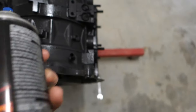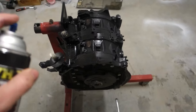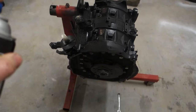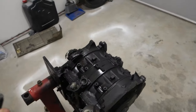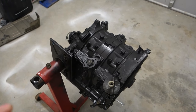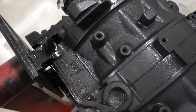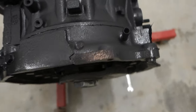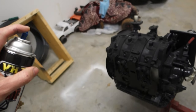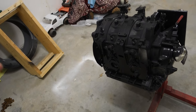I found a technique. If you take high temperature paint and you just stay kind of way back — I'd say a good two to three feet away — and you kind of just hit it like that, you'll get that nice wrinkle look. I don't know what causes it, but it works out pretty good. You just kind of keep the can far away, like a good two or three feet.